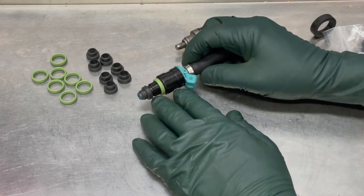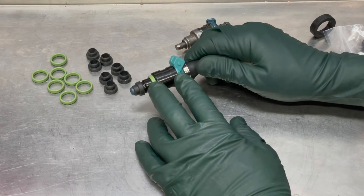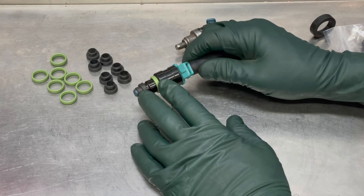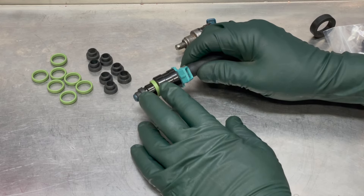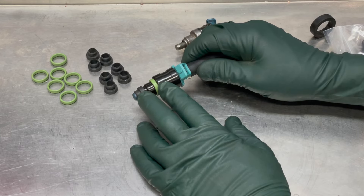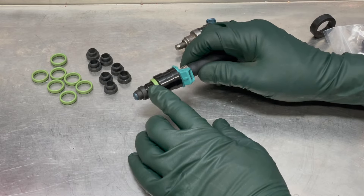I think you can see what was going on here — you don't even need to be an engineer. Mercedes decided they had to do something better to keep these injectors sealed from air leaks. So if you have a 1974 to 1975, you have to be careful because engines get changed — you've got to pull an injector and determine if you're going to need these newer seals.